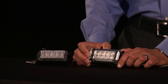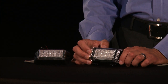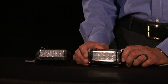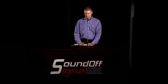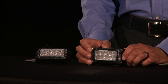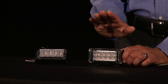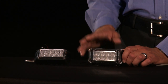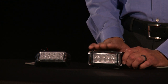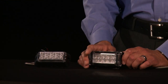There are 33 flash patterns built in. One specification that the SoundOff Predator Series meets that a lot of the competition does not is SAE J595. What that means is this light is very bright side-to-side with 180-degree light output, but also with the SAE J595 you get angled light up and angled light down. So in a hilly environment, you'll continue to get light output from this light head even if the light is pointing down or up on a slight angle.